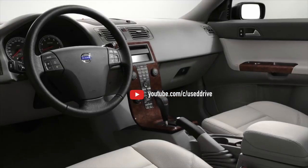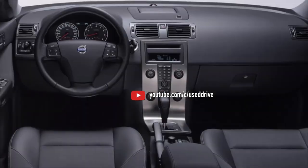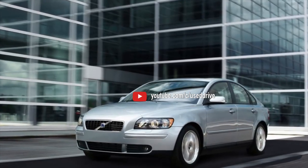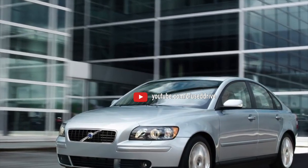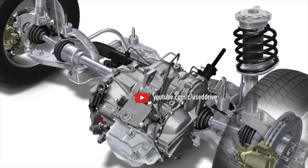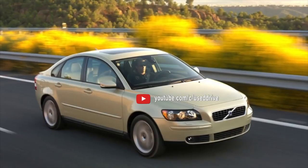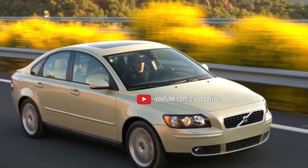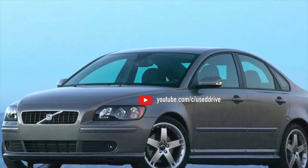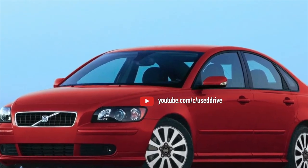The rest of the engines are pretty much the same. Engines of the B4164S series, in all variants, B4184S except those with 'SM' letters at the end, B4204S, and supercharged B4204T differ only in displacement. Of course, the supercharged ones have a different intake system and turbocharging, which is why they are somewhat more demanding in maintenance. But in general, these are surprisingly strong and resourceful engines with excellent power indicators and at the same time very economical. The supercharged versions are also tuned very well, with examples of engines on this block achieving 600–800 hp.